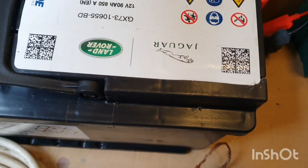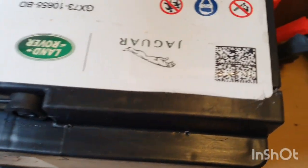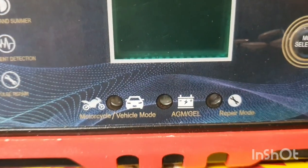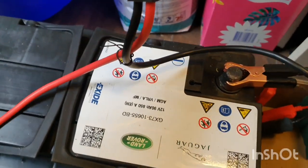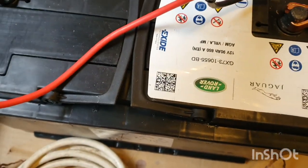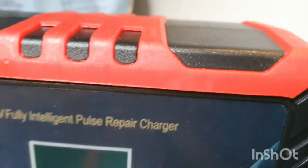I added about 60 ml of battery fluid from another used battery — which was not working, but the fluid was fine. I put 60 ml in each chamber through these tiny holes, then fully charged the battery using a smart charger that has a charge option for AGM batteries. Initially it charged up to 11.8 volts and the charger stopped automatically. With AGM batteries you need to first fully charge it, then discharge it to about 10 volts, which I did, and then recharge it fully.